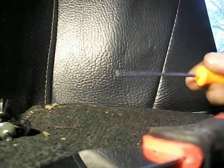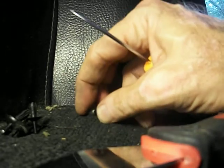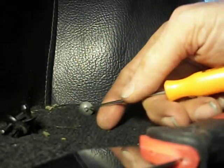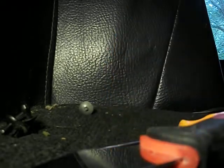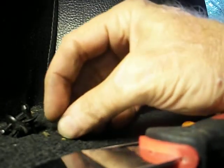It's pretty easy to do, really. A little tip for getting these little pushpins out: rather than just pushing them through and permanently losing them down some black hole, I used this tool here which has a sharp tip on it. You sharpen it to a very sharp pin, then you can actually jam this in — just kind of dig in on the side, pull that up a little bit, and then you can use some pliers to withdraw that pin. That way you don't lose the little plastic pin.